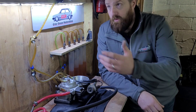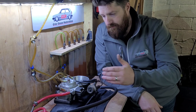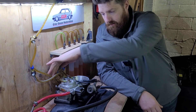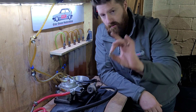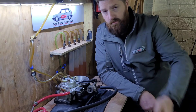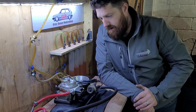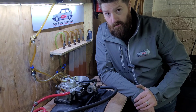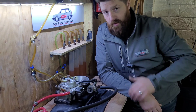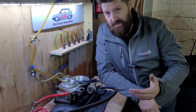To test this, the same way you'd check system pressure on K-Jet with your gauge, two lines, and a tap — but on this unit you have an output on the top which gives system pressure, and on the back side there's a test port. You put your gauge on the back port. With the tap open you get system pressure — in this case 6.2 bar. With the tap closed and cycling the ignition again, you want 0.4 bar less than system pressure.